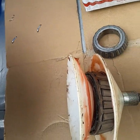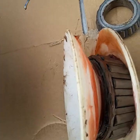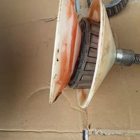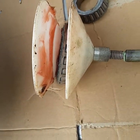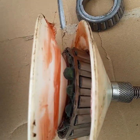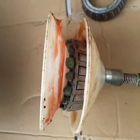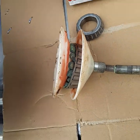You can stack bearings — like I could stack that smaller one on top — but I think they flow better when you don't. It's taking a lot of grease. There we go, we've got old grease coming out. So that's going to flush out all the dirt and debris, water, rust and stuff, and put some nice fresh marine grease in there.